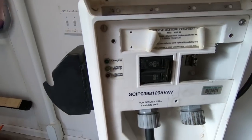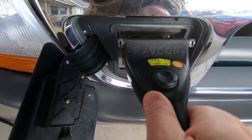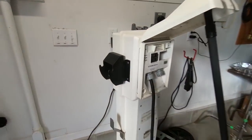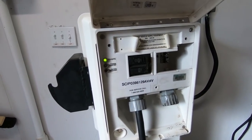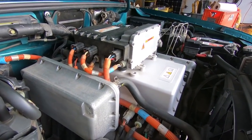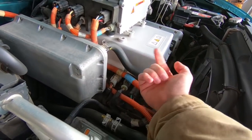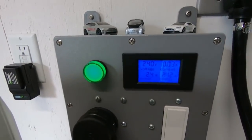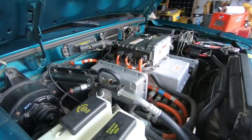I even propped this open so I could double-check the lights on here. We take the charge connector and plug it in. We heard the clunk from the EVSE over here, so the main contactor in that is getting a signal and that turns on, but that's it. We don't hear any clicks or whirs from the truck. There's a nice big fan on the bottom of this here that should be whirring away, and we're not drawing any power either.